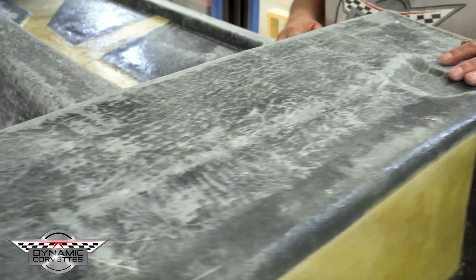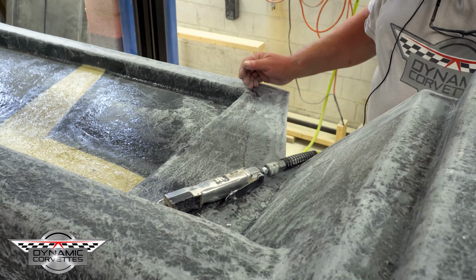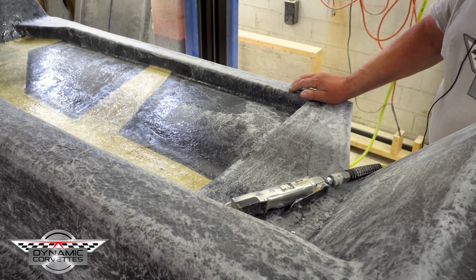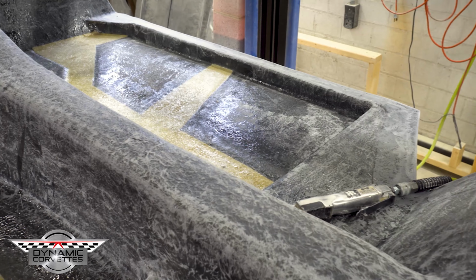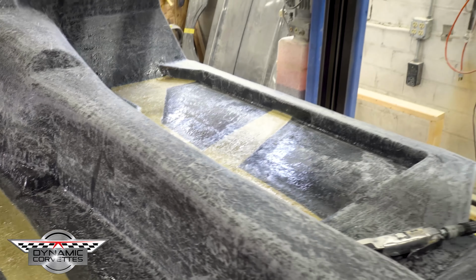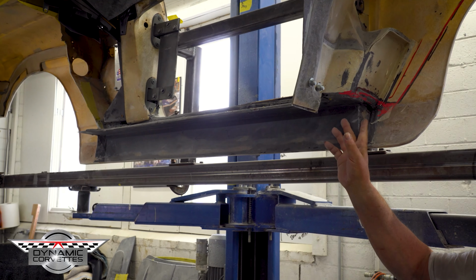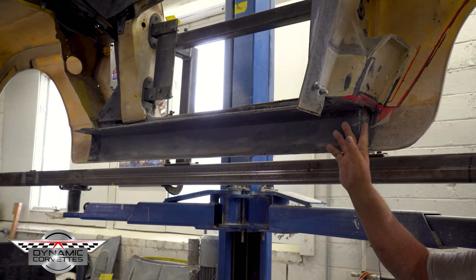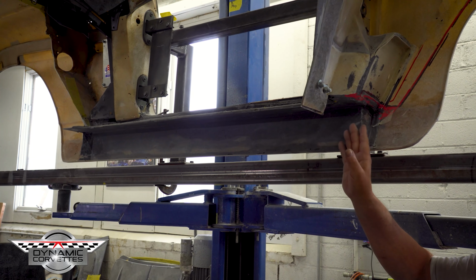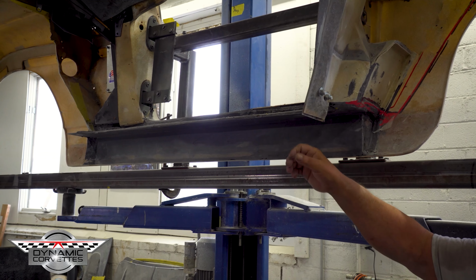Perimeter of it, all bonded. So we're prepped out. We're going to cut these out. We have our 4 alignment holes. We're going to marriage the floor to our rockers. Keep in mind, you saw the part earlier as far as putting in these rockers. Total of, I think, 10, 12 pieces to replace the factory inside rockers. So it's all fiberglass, it's all beefed up, it's rock solid.